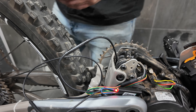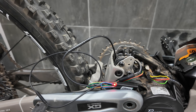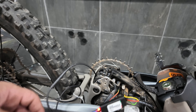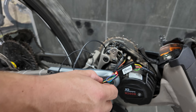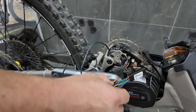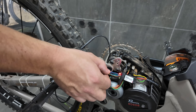With the red light on, if we rotate the wheel, once the magnet goes past the sensor the red light should go off, and then it will blip once as it goes past — turning back on. So it should go on, off, on, off. That tells us the speed sensor we've placed is working and the chip is functioning as well.